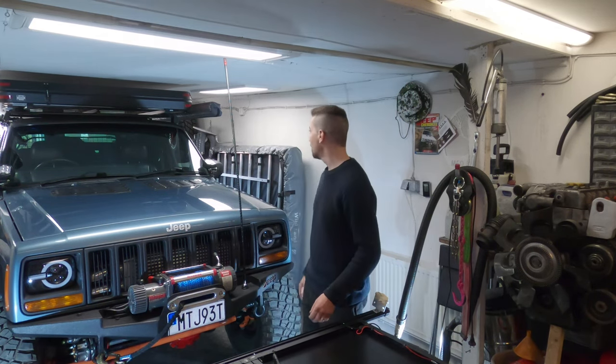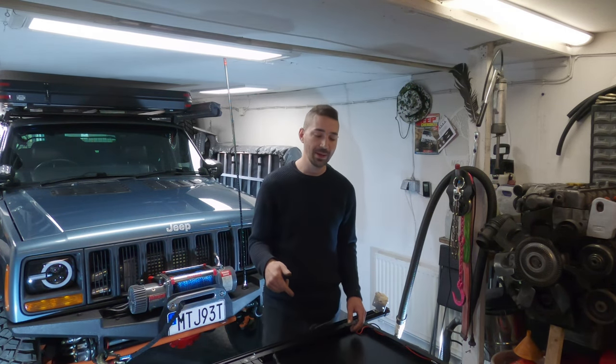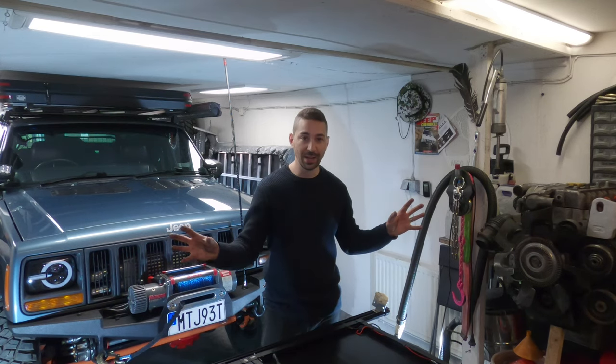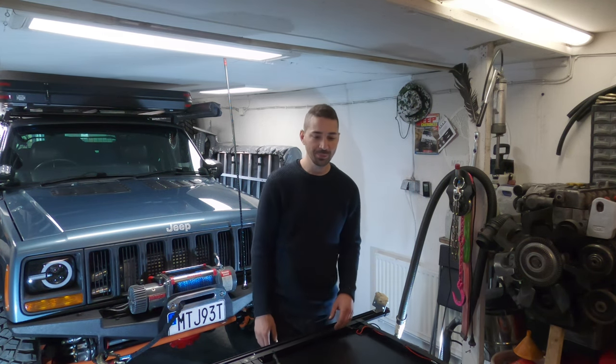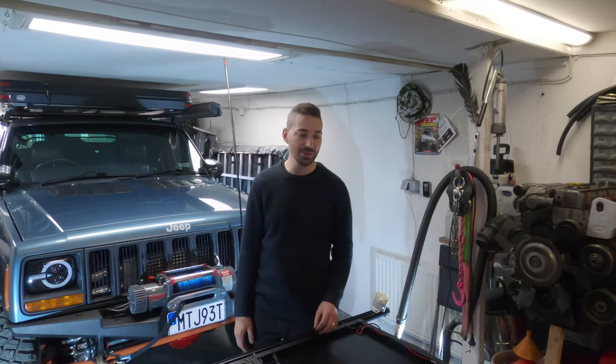It's time to get this vehicle out of the garage. I've actually blown the turbo on the Jeep, so this is not the last job. I've got a new turbo coming — it's the same one, so it's not a particularly difficult install because all the infrastructure is done. But I kinked the oil return pipe under the vehicle, the turbo flooded with oil, overheated massively, spewed oil out the exhaust and out the turbine at the front — just totally destroyed it. It still runs and still makes boost, but it's on the edge. That was a very expensive and stupid mistake.